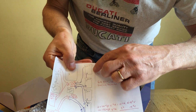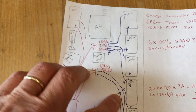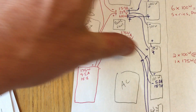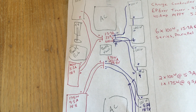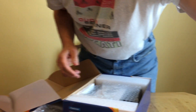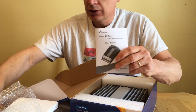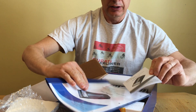The way I have my solar set up, I have four 100-watt panels on one side of the trailer, and then two more for a total of six on the other side. The chance of all six of them making maximum output at the same time is very little, so the times that I'll actually hit 40 amps is going to be fairly limited — I won't be losing very much power from the limiting.